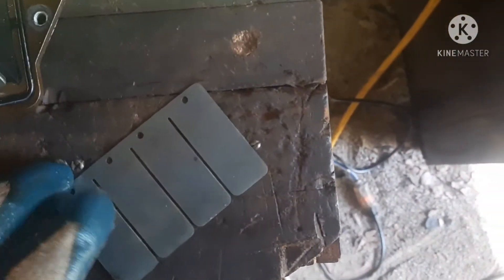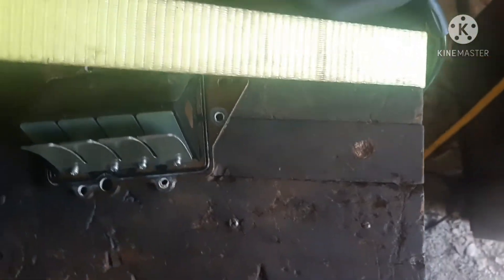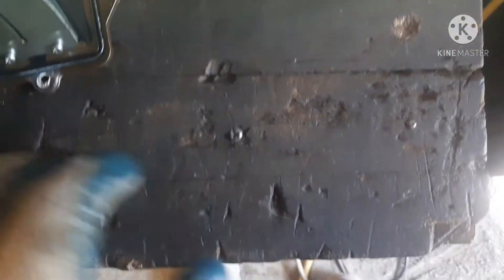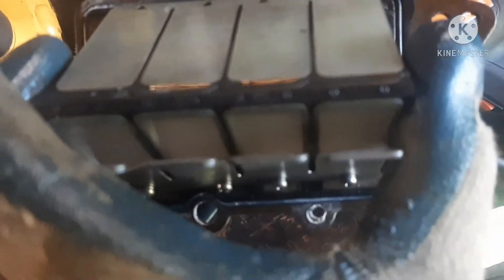So I've heat gunned this thing — these were my bent reed valves. It's not a normal plastic, but I got it to lay flat. I heated it until the oil on my bench started sweating through, so I know it's gotten pretty hot, and it looks good. I'm going to bolt it down. I've got the one side in, and you can see it looks really good now.